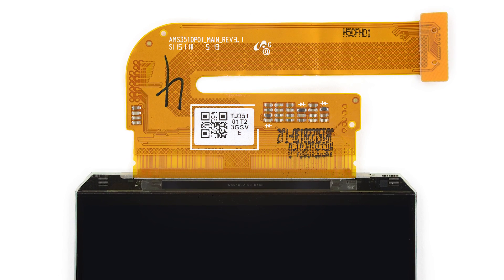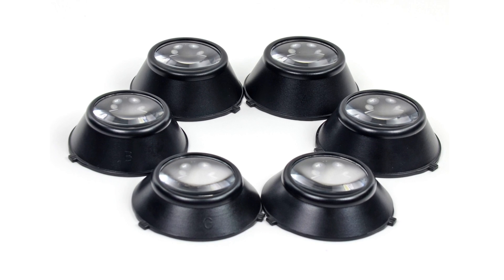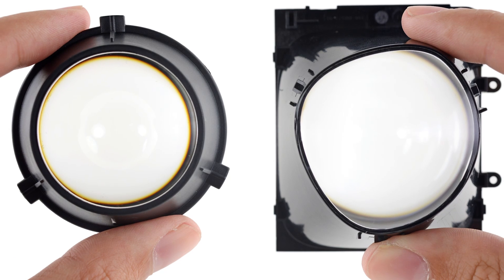Since these are mere inches away from your eyes during use, how does the Rift deal with it? It's all in those weird lenses. Where prior Oculus Rift kits came with interchangeable circular lenses, the CV1 uses a single set of non-removable asymmetric lenses, also known as a Fresnel lens. The Fresnel lens has the same large viewing angle and short focal length in a fraction of the weight, which is exactly what virtual reality needs. But it looks like Oculus took it a step further and manufactured hybrid Fresnel lenses. These lenses are made up of concentric prisms like any other Fresnel lens, but an extra sloping layer is added to the back of the lens, creating a shape that mimics a traditional curved lens and allowing the focus to vary along the vertical axis of the lens.